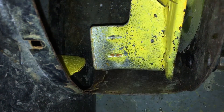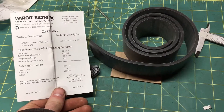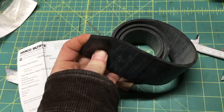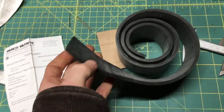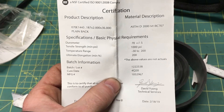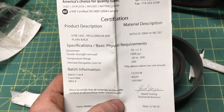I'm going to drill two holes in the metal impeller, hopefully it's not too hard to drill through, and put two nuts and bolts with Loctite on them to hold the paddle in place. This is the rubber I'll be making my paddles out of — you can use a cut-up old tire or a mud flap from a truck. I got this on McMaster-Carr. It's a two-inch strip of rubber with good temperature resistance, good tensile strength, and it's 70 durometer, so it's pretty hard. If it works well I'll put a link in the description.